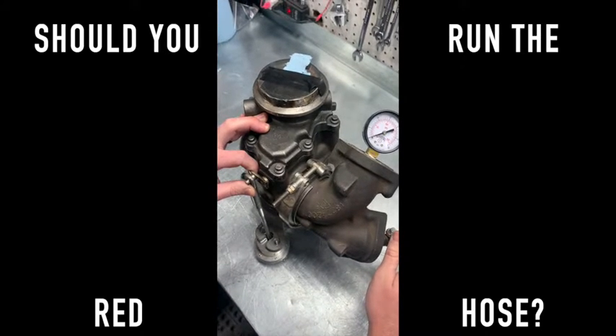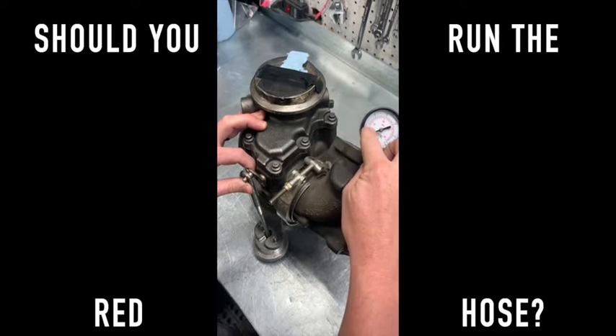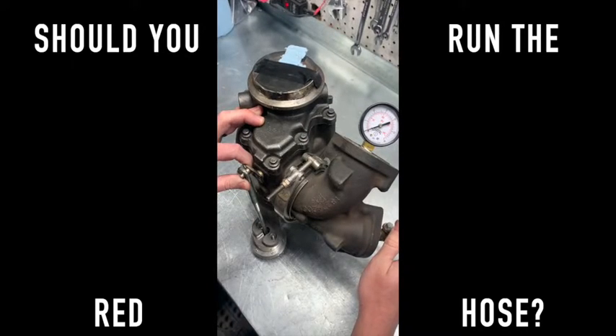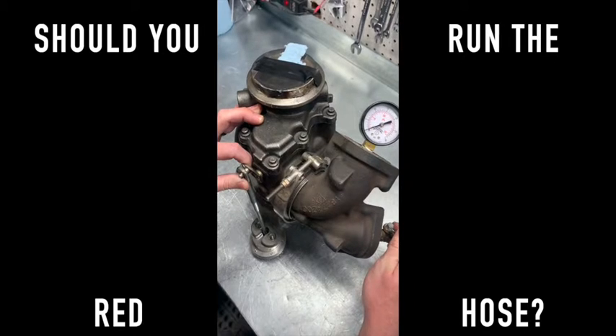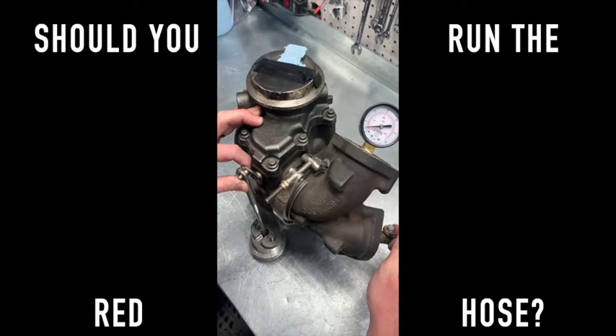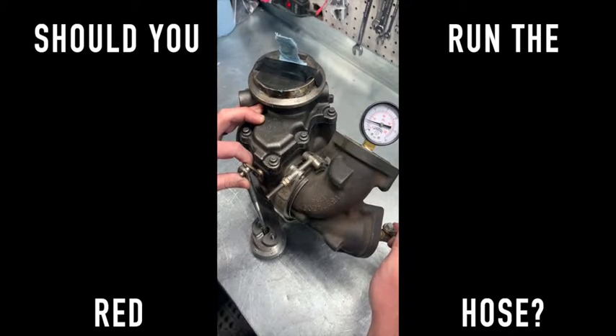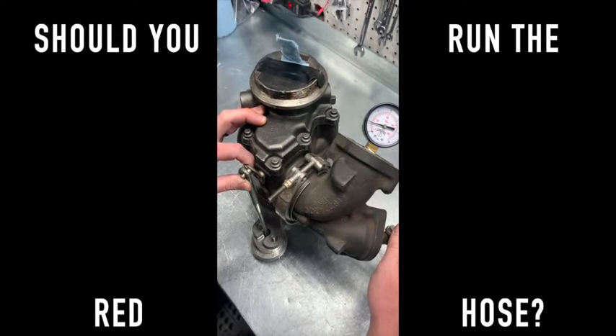This is about as loose as you can go on the spring. Watch the pressure and the little piece of paper that's going to flap, and you'll see when the wastegate starts to open. See how it's immediately starting to open just a little bit? So that's 5 PSI - that's about as loose as you can put it on there.